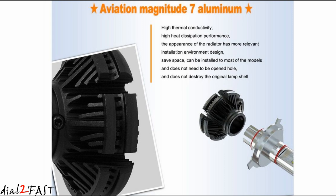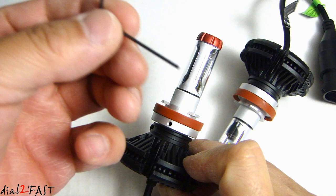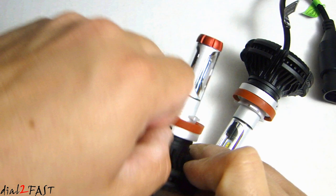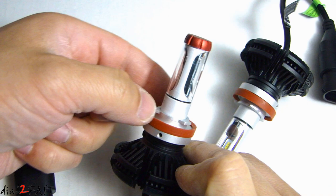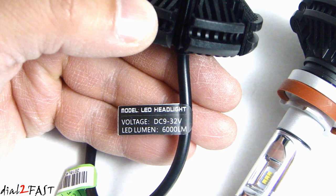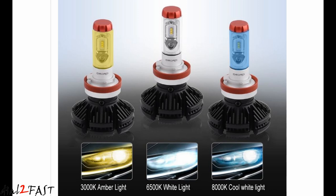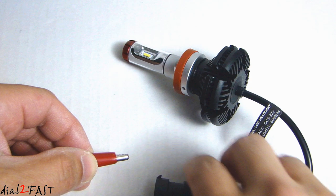This light is IP67 rated, so it's waterproof. Another nice feature is if you look at this hole right here, they've included the Allen wrench to loosen the set screw. When you loosen this, you can actually rotate the base for the socket, which allows you to adjust the beam pattern to match that of your halogen lights. On the wiring, there's a tag that tells you this light operates between 9V to 32V, and outputs 6000 lumens. The color filters that come with these lights are stickers, so you can peel them off and stick them onto the glass surface. For my application, I'll leave it clear, so I'll get 6500K, which is a pure white.